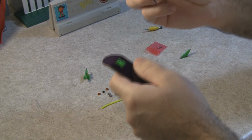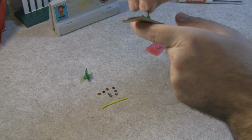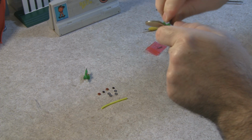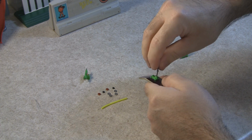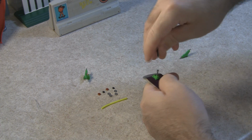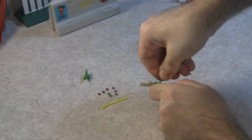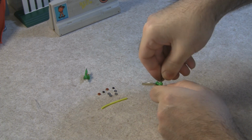Now we're going to start the kingpin in there. I have it on the wrench. So you got to try and keep it straight this way and at that little slight angle this way. And then get it started. Now push down kind of hard. Because like I said, you're cutting the threads. But believe me, it'll be worth it because they'll fit nice and tight and you'll never have to worry about them.